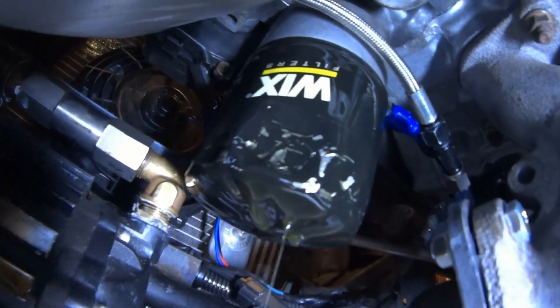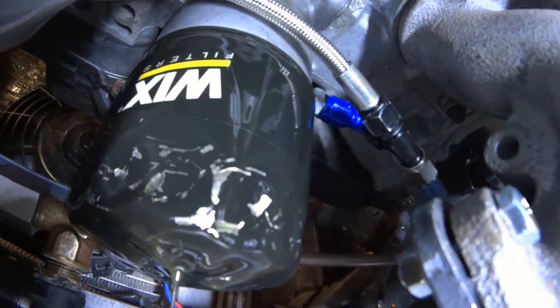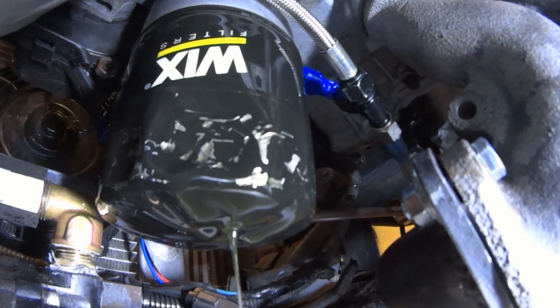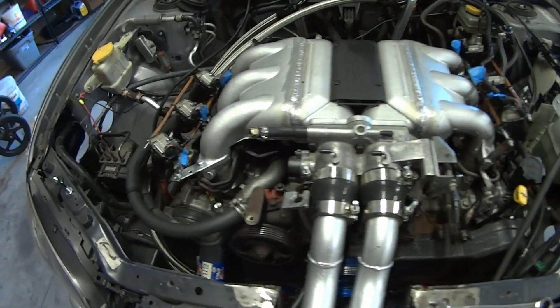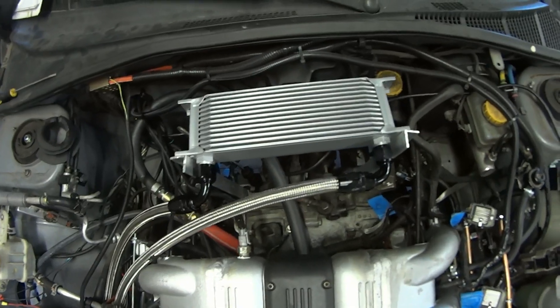The documentation, which I've posted in the description, actually recommended a 1989 Chrysler Conquest oil filter, which I have since installed and it does not leak. This twin turbo build is really coming together. You might want to stay tuned for the next episode when Dan Jordan and I attempt to fire this thing up.